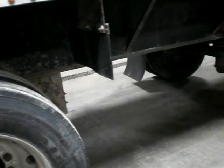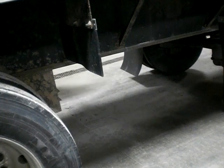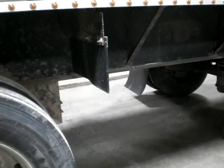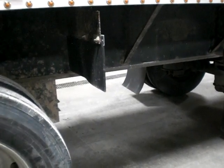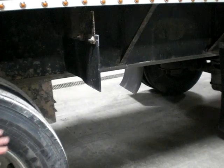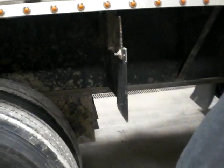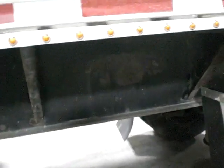I'm looking at my tires, the frame and cross beams of the trailer, my DOT tape going along the side of the trailer, my chicken lights, or technically service lights on the side of the trailer, and I'm looking up and I'm doing that for everything, making sure the airbag on this side's the same as it is on the other side, my mud flaps and everything, all of my tires as I've previously stated.